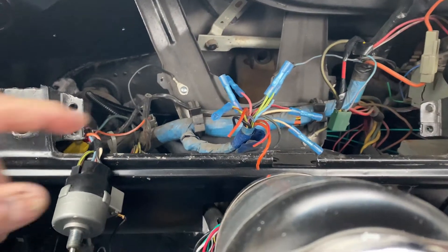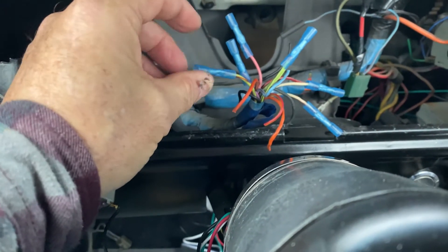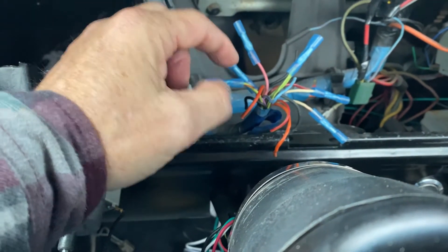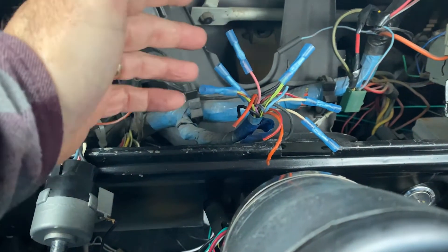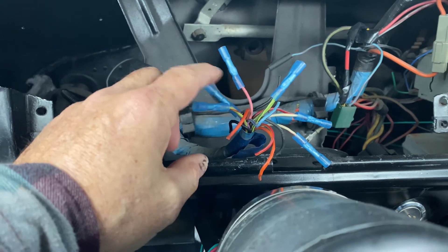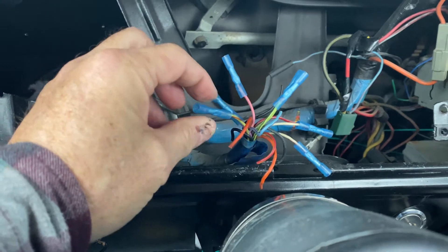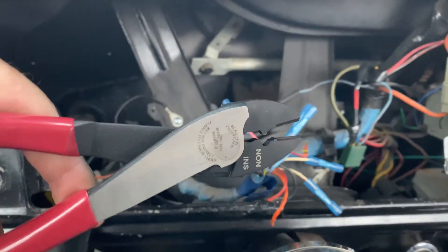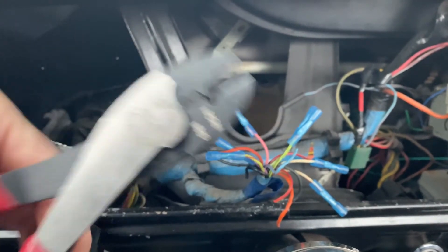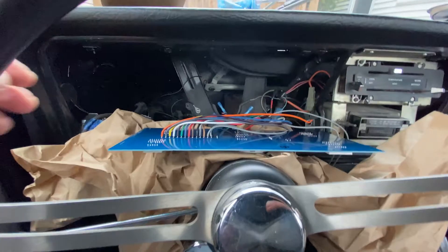I've got these connectors on — no big deal, that was pretty simple. I just put them in there and crimped them, and this is heat shrink as well. If you wanted to solder them then crimp them, that's probably the right way to do it. But don't just use wire caps — over a period of time they're going to shake loose. Use legit crimpers, not pliers. The crimps with the nice dimple there really will mash those down.